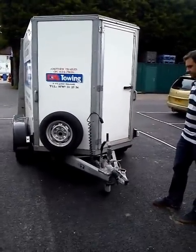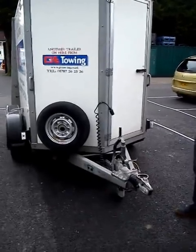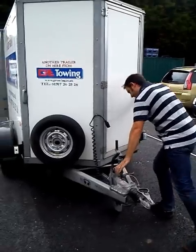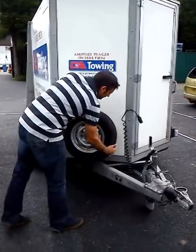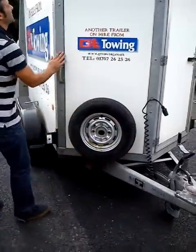What this actually means is you must do a trailer check. The first thing you need to do is approach the trailer and check the handbrake. Give the trailer a bit of a push as well, just to make sure that the vehicle is nice and secure. Then you do a 360-degree walk-round, so physically touch everything that you see. We're checking the tires there and checking the nuts to make sure it's secured onto the actual unit.